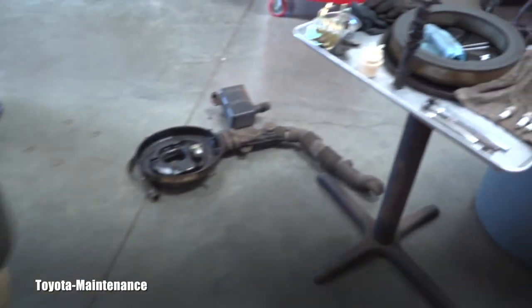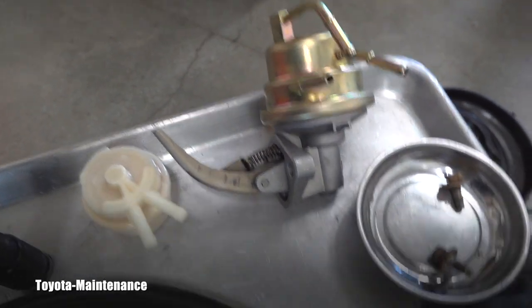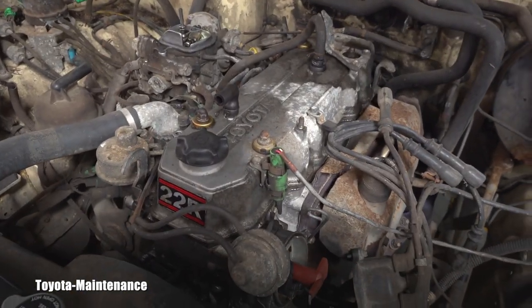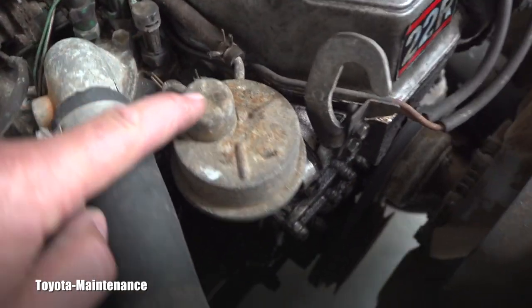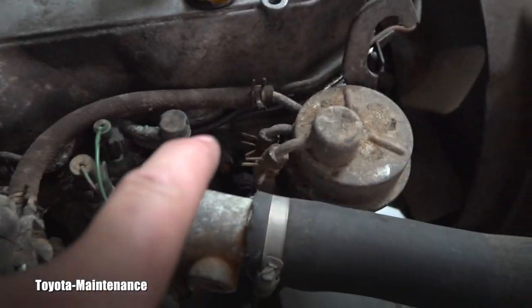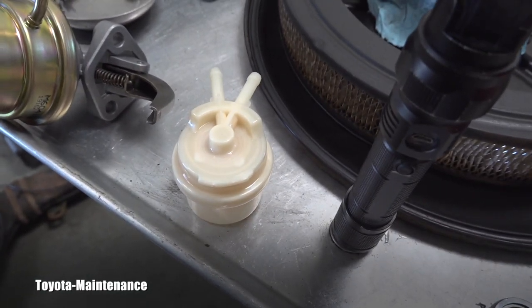What do you need to check? Fuel pump and fuel filter. Now these are the new ones right here — fuel pump, mechanical. We are back in the mechanical times; there's no electronic fuel pump in the tank, purely mechanical. You can see where it's mounted right here. This is the old pump, held by two screws, one on each side, powered by the cam.